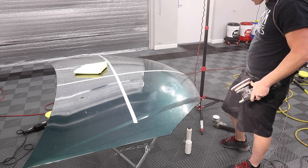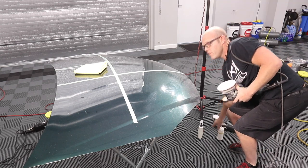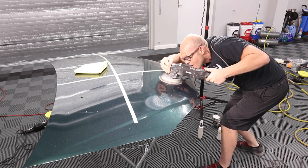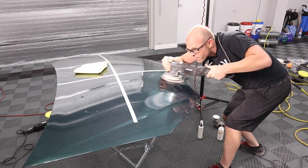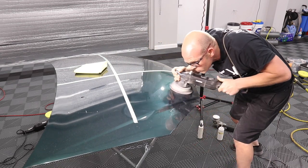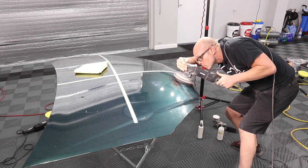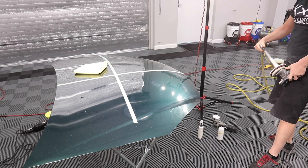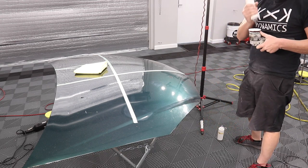Now I got a good amount of scratches on that first one, and there really wasn't even a lot of product on it. So right now I'm putting 101 and 205, just because I'm watching how it moves on the panel. What's that wiggle you're doing there? Just because I'm getting close to the edge, so it's kind of like a little scrub technique. Now I'm switching machines to basically knock out the portions that are a little smaller.